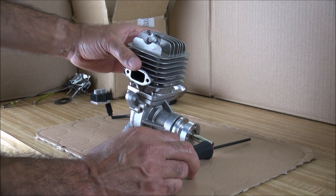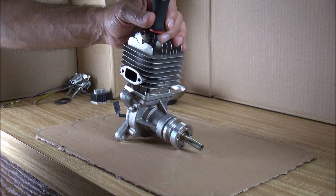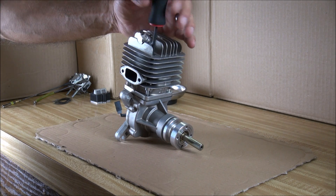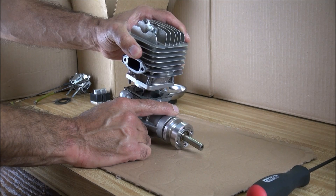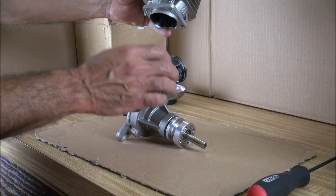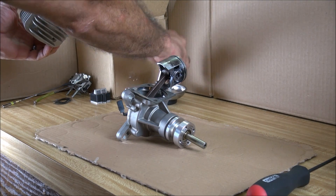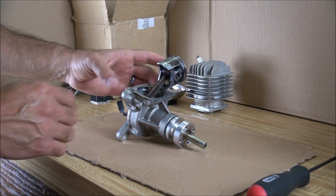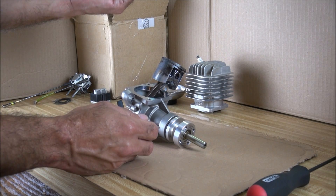Next thing you're going to have to do is take the cylinder head out. For that you need to remove four screws. Once those are removed you just pull on your cylinder head. Watch out for the cylinder. You're going to try to extract the four screws — not to loosen them — I'm going to put them on this magnet tray. There's a gasket right underneath that we're going to replace with new gaskets.